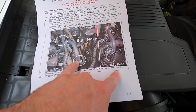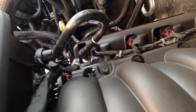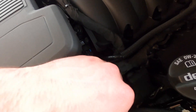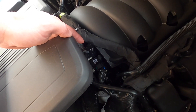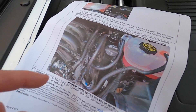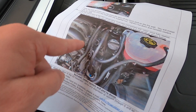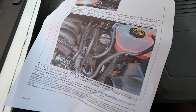The 6.2 has a different hose than the 5.3 but it's essentially the same thing. Over here, that's our passenger side one right there — goes from that side up into the intake. Right here on the 6.2, our driver's side goes right here and then up into the beginning of the front of the intake manifold, right there behind the throttle body. On the 5.3s they go from here to right there — that's why it had the hose bent around like that. So if you get a 5.3, yours goes here; on us 6.2s our hose runs right here.